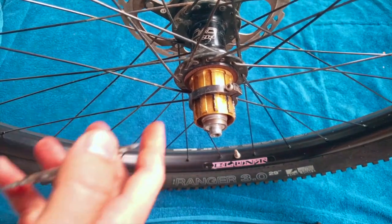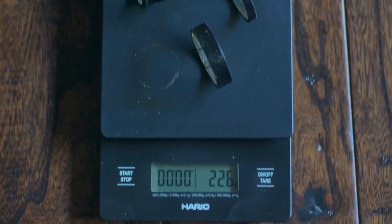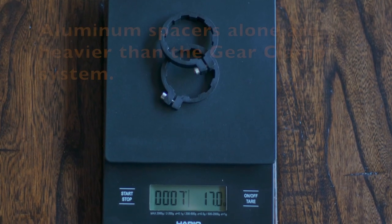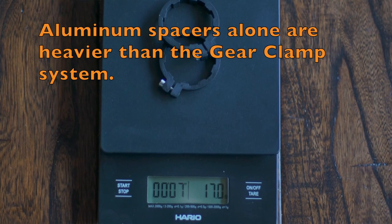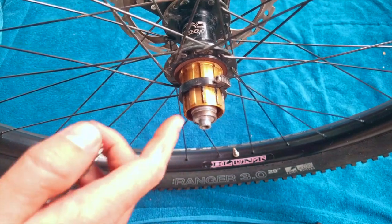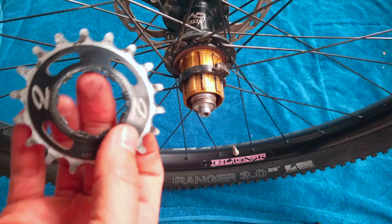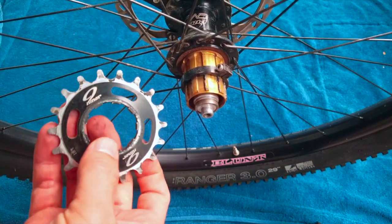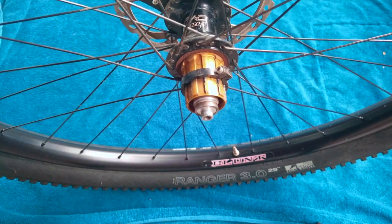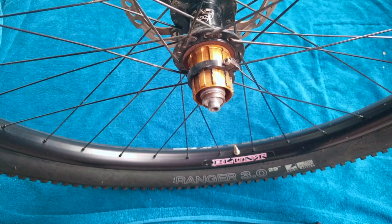The upside to the system is that it's simple — there's fewer spacers, so it's a little bit lighter weight, though you have these bolts as well, so it may or may not be lighter than the system you're already using with the lock ring. But what I really liked was that you didn't need that lock ring, so I didn't need a chain whip or anything to remove my cogs. It's a really nice way, if you are racing, to just bring a few cogs, go ride the course, test ride it, and figure out if you need to drop or add a tooth or two.